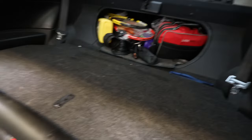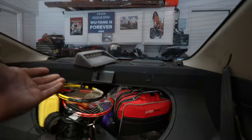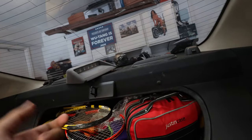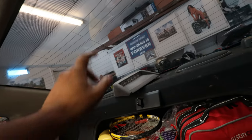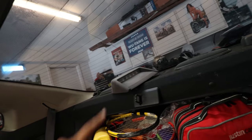Alright, going into the G35 — first things first is to get access to the third brake light. I ended up putting down the seats. We do need access to the third brake light so we can get into the wiring. It does have a connector so we can go ahead and disconnect that and then piggyback off of the connector and use the wiring there. Let's go ahead and get started — we'll disconnect the connectors in the back of the third brake light and go from there.